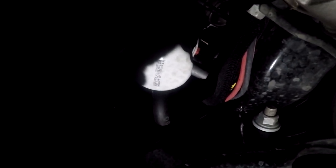This right here is the drain plug that has to come off — that requires a 13 millimeter socket. And this is your oil filter right here. This is my third change so this shouldn't be too hard to get off. I'm gonna give you some tips on how to pull this thing out without getting oil everywhere, because once that plug is removed the oil is gonna shoot everywhere. That's why I have my drain container down here.